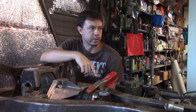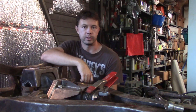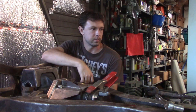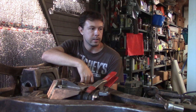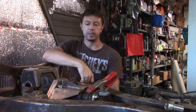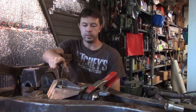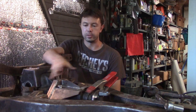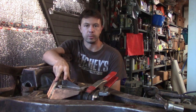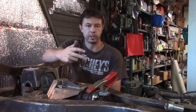When I mounted the engine and transmission, I did it so that the oil pan, the bottom of the transmission and all that is more or less flush with the underside of the frame, so I've got nothing sticking out lower than the frame. I managed to put the mount over top of the differential, so that doesn't reduce my ground clearance at all or complicate the exhaust routing anymore.